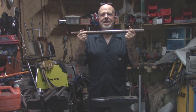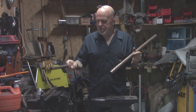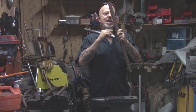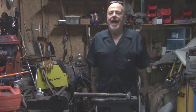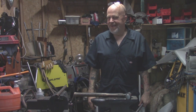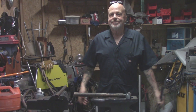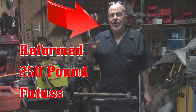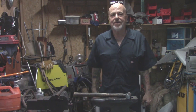So you've got a long stretch beach cruiser and you want to put a 70-80 pound engine on it and have that thing flexing. Sure, steel will flex, but consider this: you've got things welded together, and where things are welded there's what's called the heat affected zone — it's slightly weaker there. And some of you riders, let's just say you're a little bit overweight. These things weren't designed for a 250-pound person on them, not with this thin metal they build them out of.